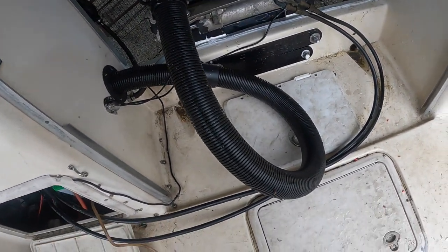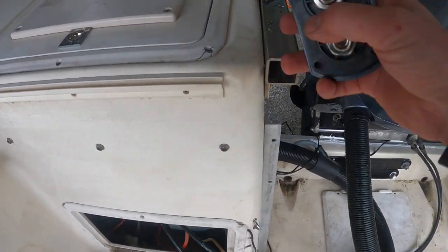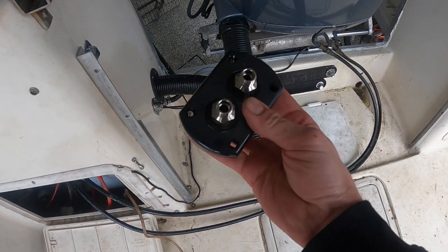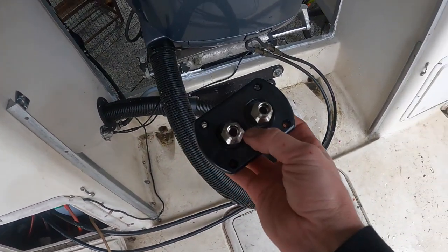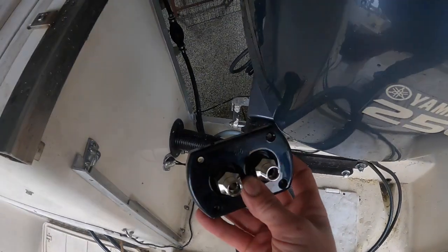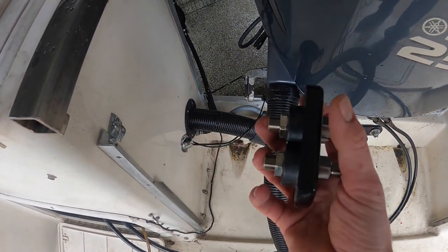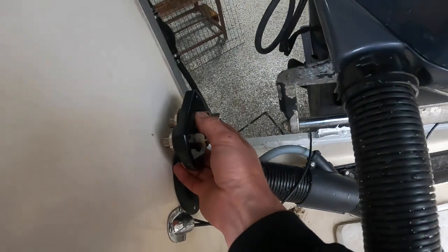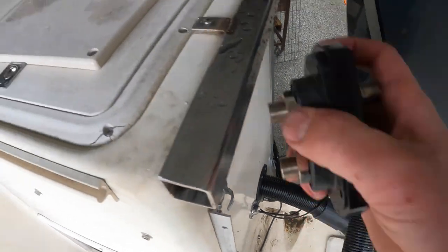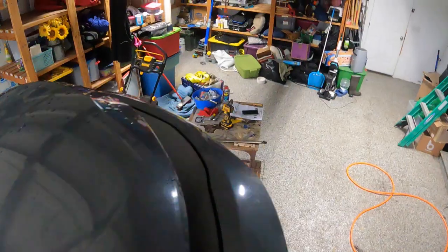But I'm going to clean this up, and in doing so, I'm going to install this through-hole fitting, or this end of this bulkhead here. I got this from a company called CP Performance online. I'll leave the link in the description below. But my plan is to put this right about here and use some reusable hydraulic steering lines, or excuse me, reusable hydraulic fittings.